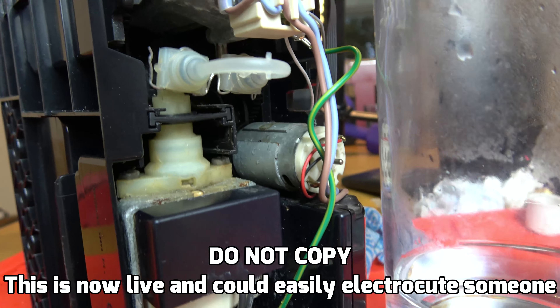I'm keeping my hands well clear. Obviously do not copy what you see in this video - this is purely for entertainment. I'm going to plug it in now and physically see if we can see water coming out. It's on - I'm going to push it forward and water should start to come through. It's flying out right there - I'm going to unplug it. So clearly it's leaking from up here and working its way down, and it's a very bad leak. Let's take this off now and see if it's limescale-related or if there's a split.